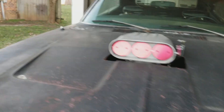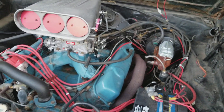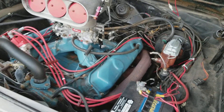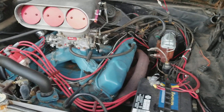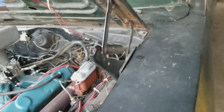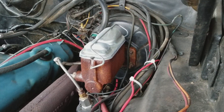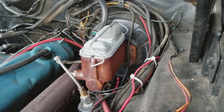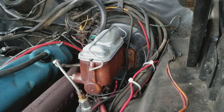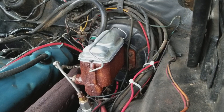The only issue I'm having is how hard I have to push the pedal. Some of that could be the cam I have, because the cam does not have a lot of vacuum, and that probably has something to do with it. I have heard that people doing upgrades like this have gotten different master cylinders. I just got one for a '68 Charger with disc, and that's what I put on — it was just the easiest thing that came to mind.